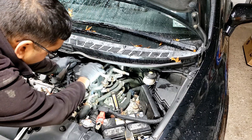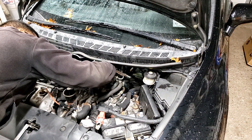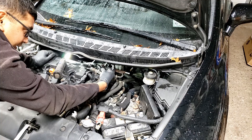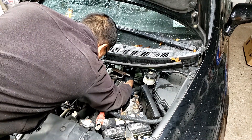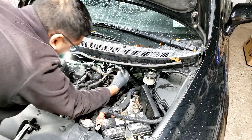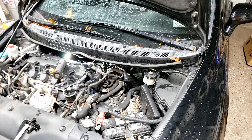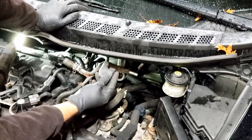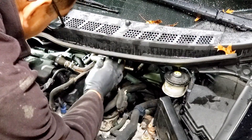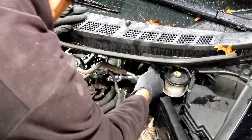Now I have enough free play. There's a clip for the throttle position sensor right here — press the tab and pull it out. There's another one; that's the idle air valve. Push it down and it'll release. The bolts look like they're 12s — yeah, they're 12s. Should be able to get to the bottom one.